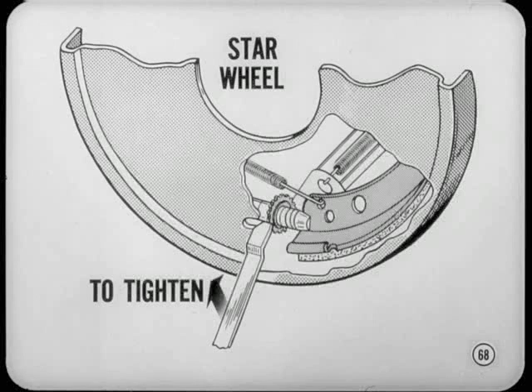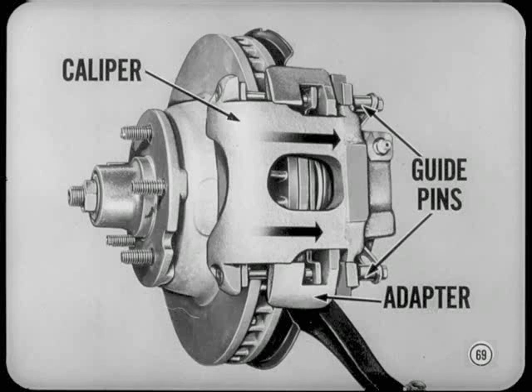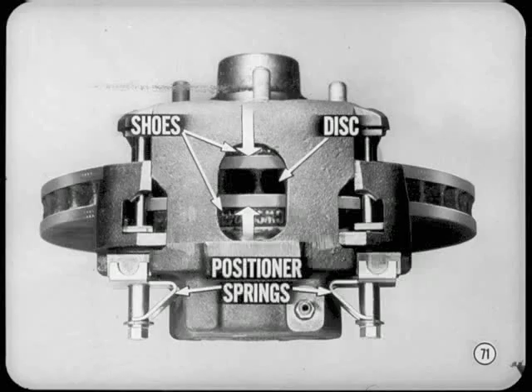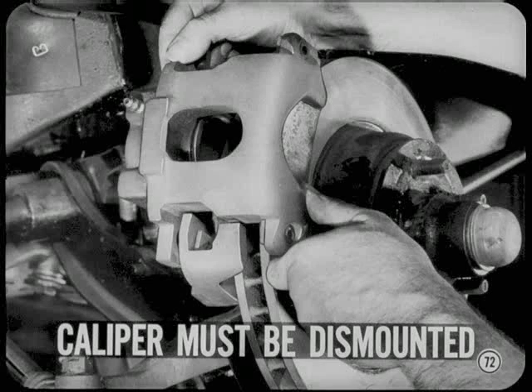Now you move the adjusting tool handle upward to tighten and downward to set the initial adjustment. A new single-piston disc brake is used on our full-size cars except Imperials. When the brakes are applied, the caliper moves inward on two guide pins in an adapter casting mounted on the steering knuckle. Pressure reaction between the caliper and its piston causes the shoes to clamp the disc. Hydraulic pressure forces the piston and the floating caliper to move in opposite directions. Since the caliper extends over the rim of the disc, its inward movement pulls the outer brake shoe against the outer side of the disc, while the piston pushes the inner shoe against the opposite side. Both shoes are clamped with equal force. When the hydraulic pressure is released, positioner springs on the guide pins retract the caliper. The single-piston brake caliper must be dismounted for brake relining — complete relining information is given in the service manual.